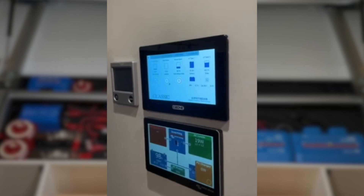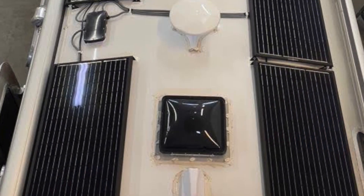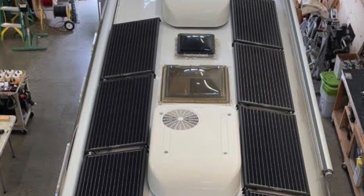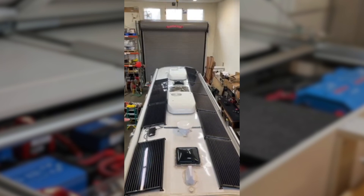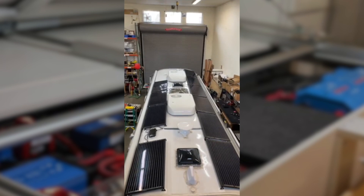Taking a look at the roof now — we've got Zamp Obsidian solar panels up here. These are the 100 watt Obsidians and we basically maxed out the roof with as many panels as we could fit. If you look at the last panel, it's actually lifted up a little bit — we did that to clear a vent just so we could add one more panel. Because we're running 24 volts on the batteries, you have to run an even number of panels in series pairs. We're using our series pair connectors from the ATPS, which runs over to our combiner box. You can see there are about half as many cables going into the combiner box as we have panels up here. It's a good-looking roof and it's probably going to be generating a lot of solar.